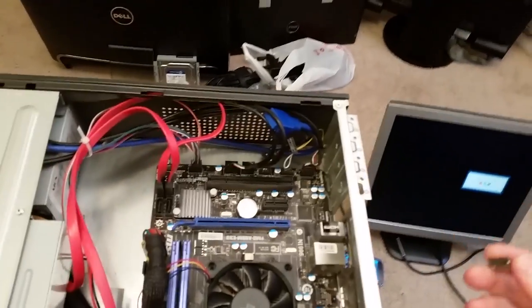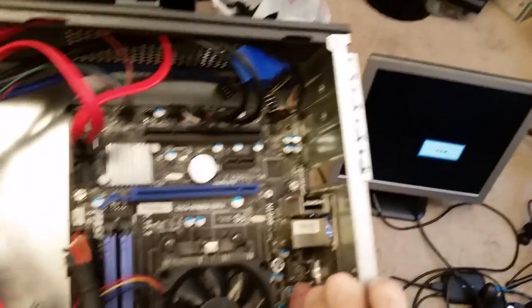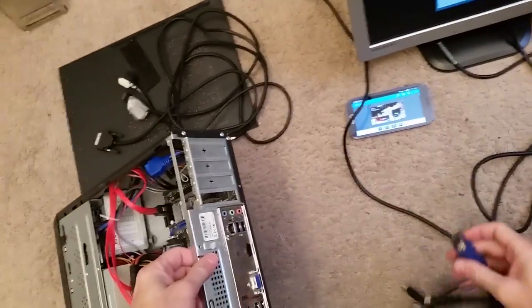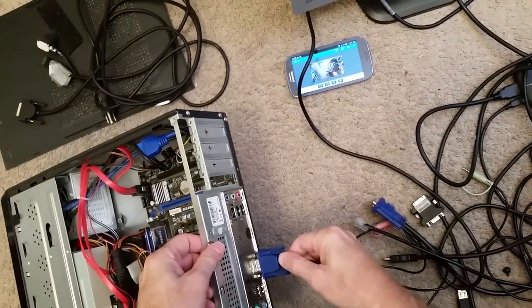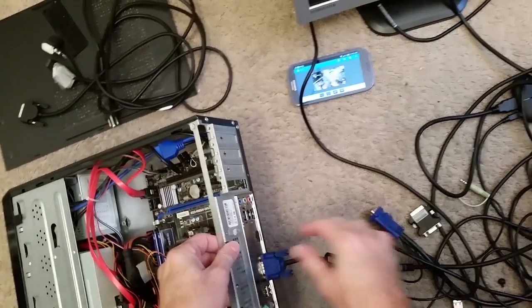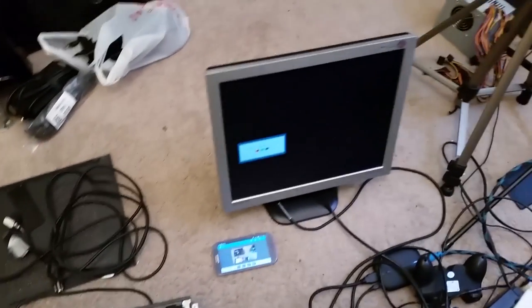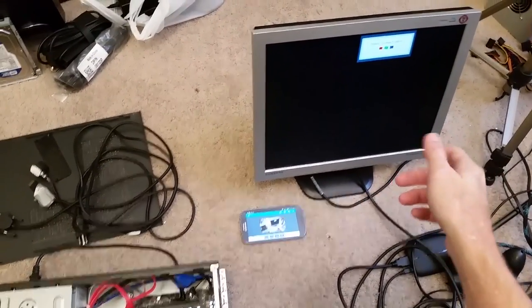It's not in very good shape and the likelihood of me being able to re-solder it back onto the motherboard right down there is not good. They already tried this at their place — they told me they tried hooking up their monitor to the VGA port here, and I did the same thing. The computer comes on but no signal is going to the monitor, so basically just getting a black screen.